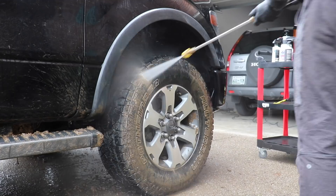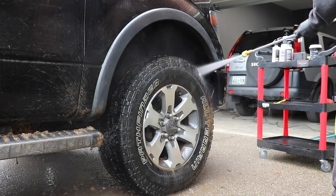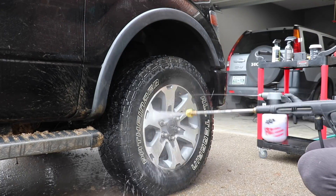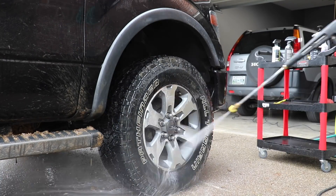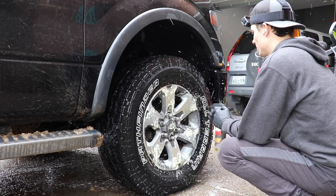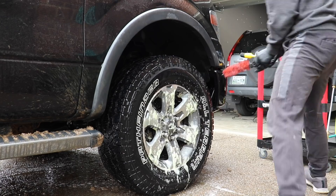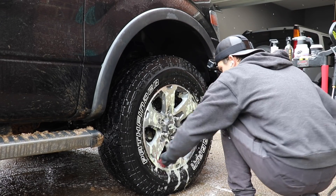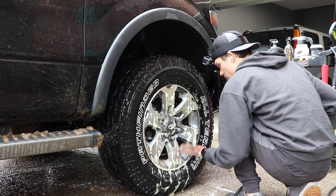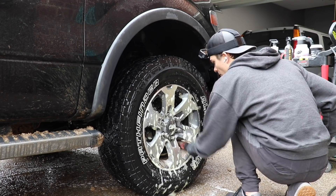When dealing with a super muddy tire, it's sometimes hard to tell what kind of brake dust you're dealing with because it's so covered in mud. I approach detailing like a funnel — I'm blowing it all off with the pressure washer first, then rinsing. I'm applying degreaser with my pressurized pump sprayer to start removing it more and more. I'm pulling out my smaller version of the Speedmaster brush because the brake pad is really close to the inner barrel of the wheel. Every single car is different, and if you don't have the right tool, you literally won't be able to get the job done.